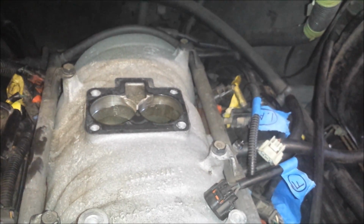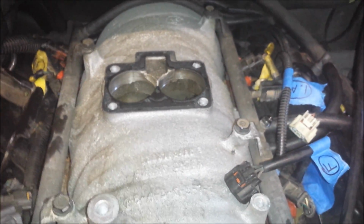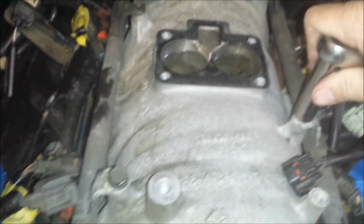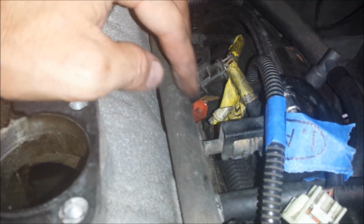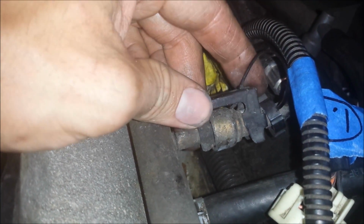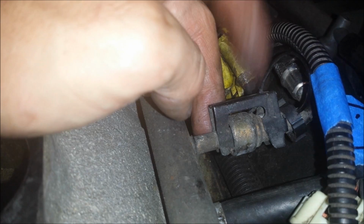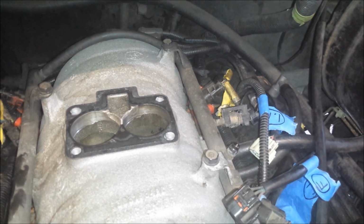And I believe those are, let me see if those are 1/2 inch. I believe they are 1/2 inch. Let's see. Yep, 1/2 inch bolts. So there's 4 of those. Then there's a flexible fuel line here that connects one rail to the other. And then there is a fuel quick connect connection here, and I'll undo that as well. I just need to grab my disconnect tool and I'll show you how to do that. So let me get my act together and I'll show you that part.